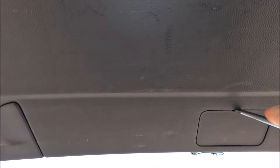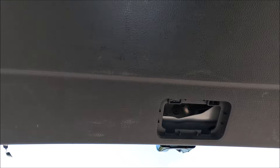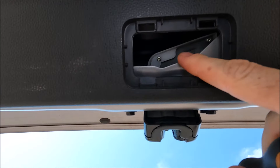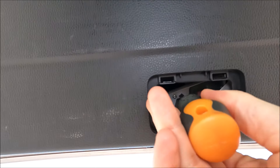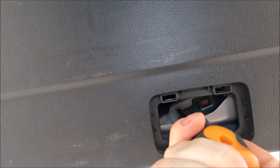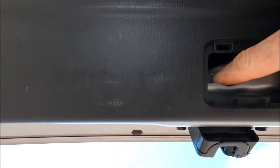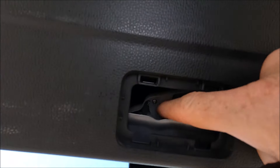What we're going to do is first pop our screwdriver in there and remove that cover plate. Then if you look inside, there's a white nylon piece of plastic — we're going to use our number two screwdriver and undo that just about a turn and a half, and that will allow you to move it with your finger out of the way — you can see it moves there.